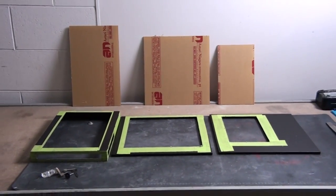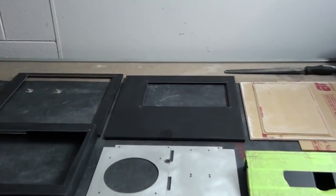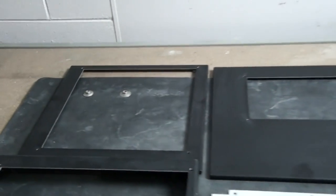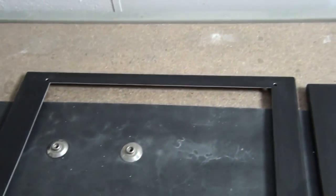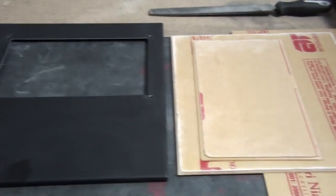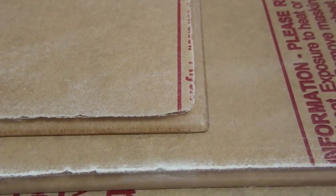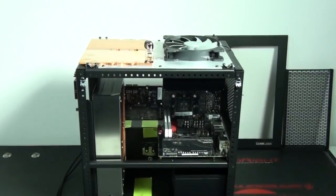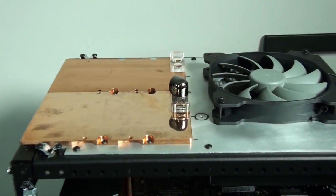If you missed the last video - Singularity Computers Client Build 15 Build Log Part 2, which was also a subscriber update - I'll put a link on the screen. I've now completed both of the side panels, the top panel cover, and all of the acrylic windows. I've also cut down the acrylic inlet/outlet sections on the hard drive water blocks, solving the problem of the top panel cover not fitting over the 90-degree fittings.